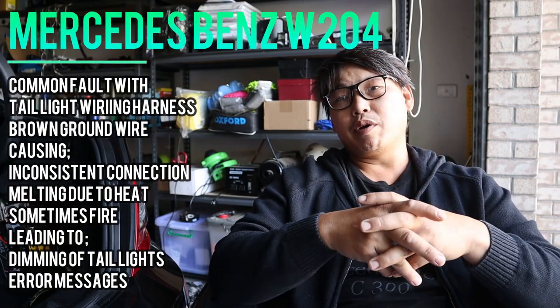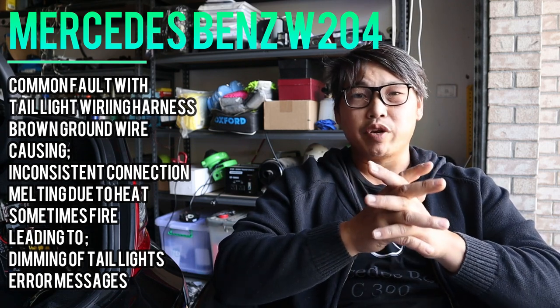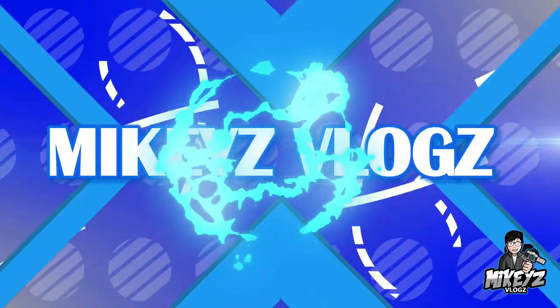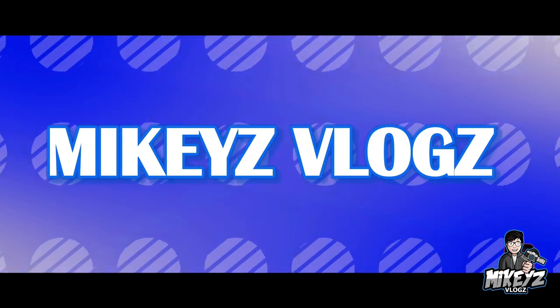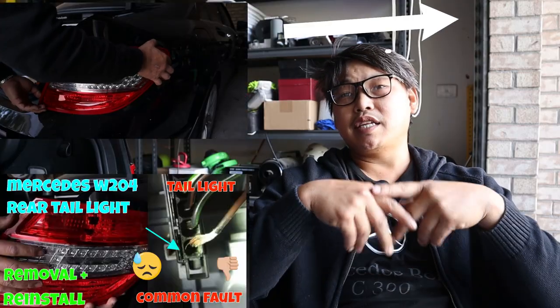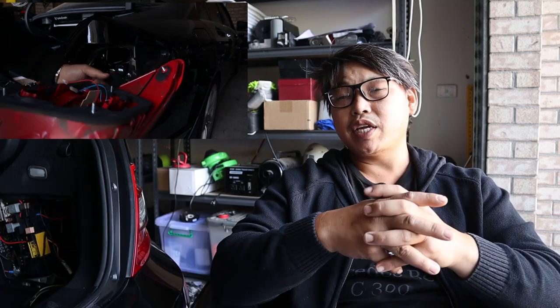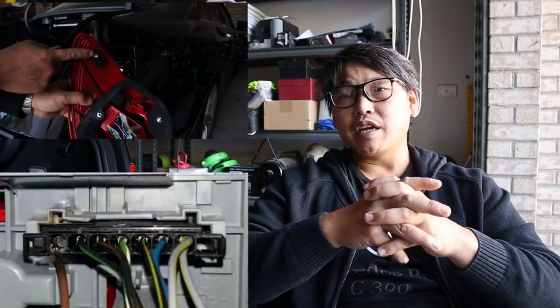In this video, I'm going to show you guys how you can fix the common fault relating to your rear tail light assembly. A while back, I did a video showing how to remove your rear tail light assembly, and in that video, I gave a brief description on why there is a common fault with the W204 relating to your rear tail lights. Specifically, the brown ground wire.